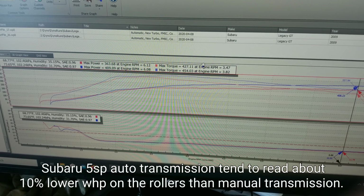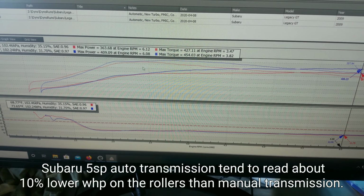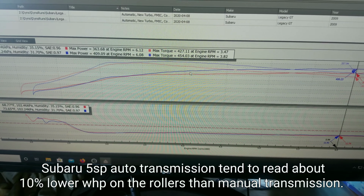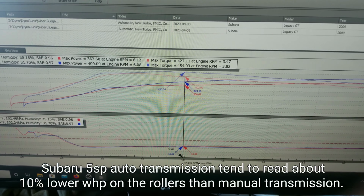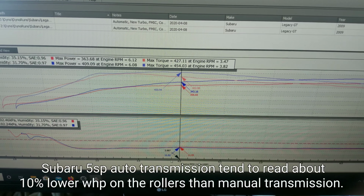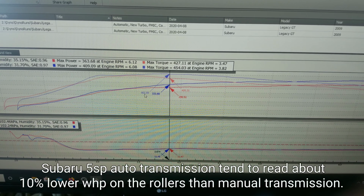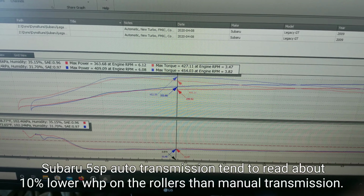Now the torque is actually probably more real on this pull. You can see, typically on the autos, the converter flashes and then it kind of falls off, and that's when you're doing a wheel speed match instead of an actual RPM pickup. But at about 3,800, these things lock up. So at 3,800, we are at 452 foot-pounds of torque, which is going to be obscene.